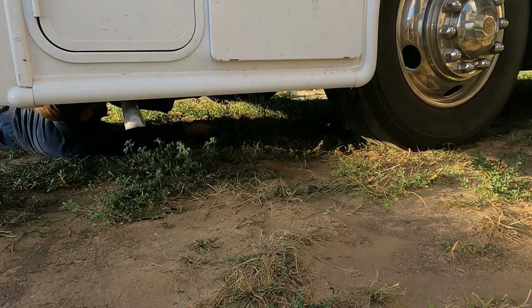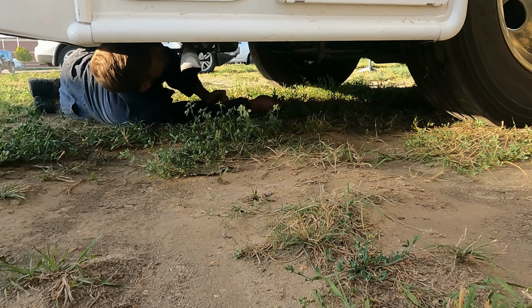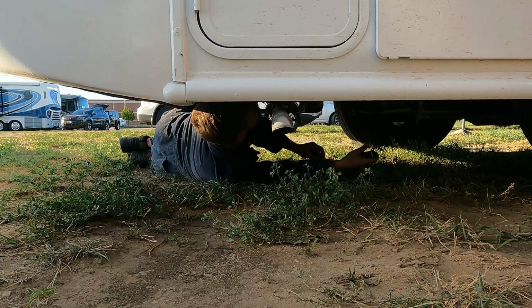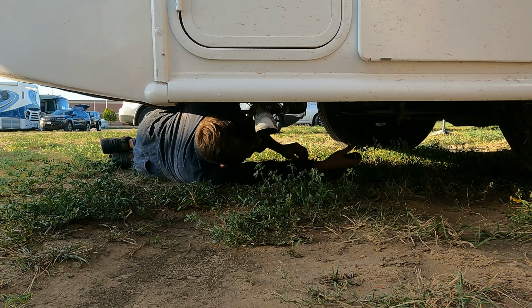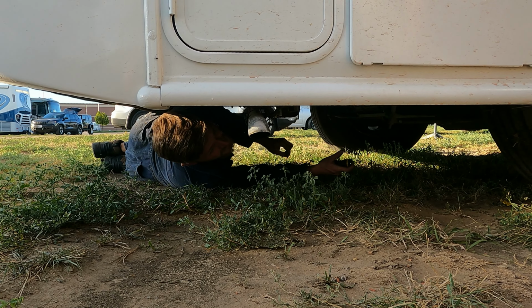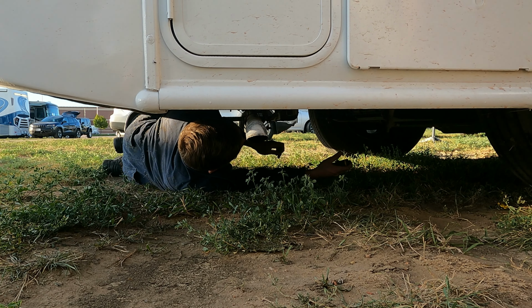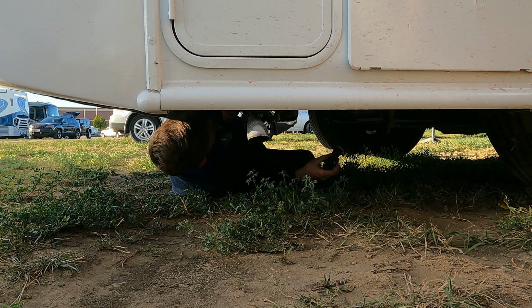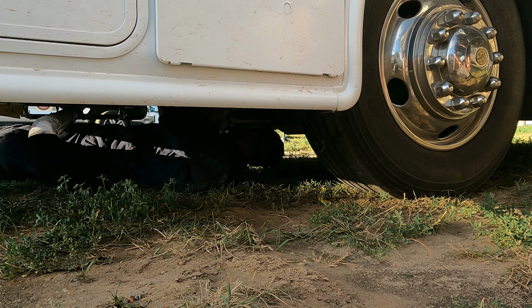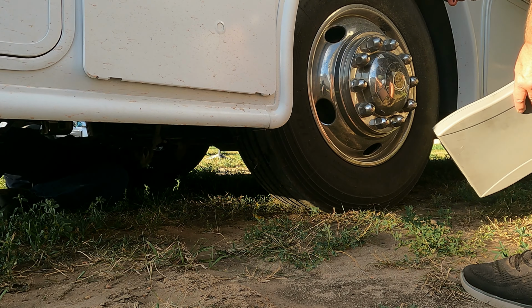Okay, got it marked. It's funny, some of the older ones seem like they were built to a different spec, so I don't know. You think the Safety Plus helps them at all? Safety Plus could definitely be overcoming some stiffness in the steering. But the bell crank will just help that work better. That rear tie rod end looks okay. Both of the tie rod ends look okay.